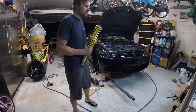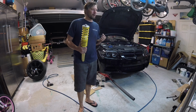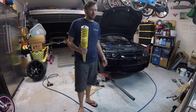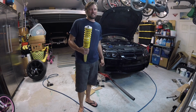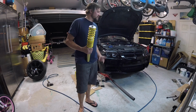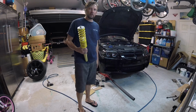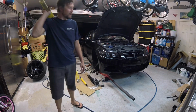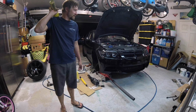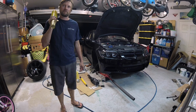I did a little research. There's cheaper kits out there that offer more parts, come with the strut pivot bearings, things like that, for less money. This kit is just the struts, springs, rear shocks, and springs. You don't get the pivot bearings. I looked at it like I'd like to keep as many of the parts BMW as possible, since I was going cheap.